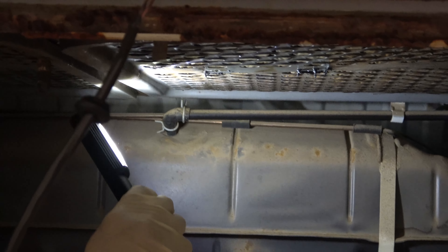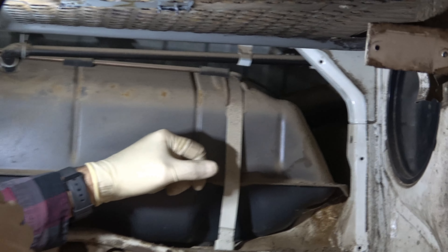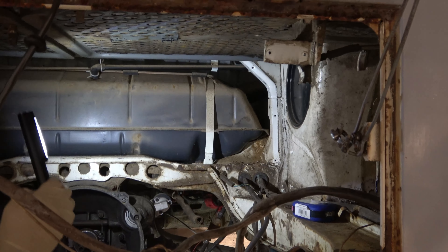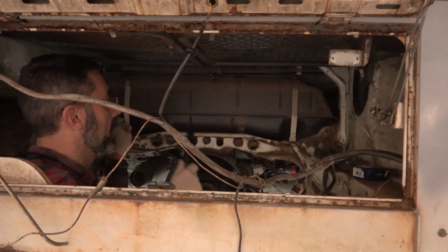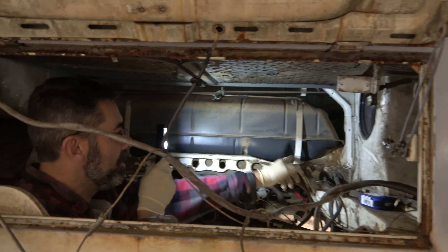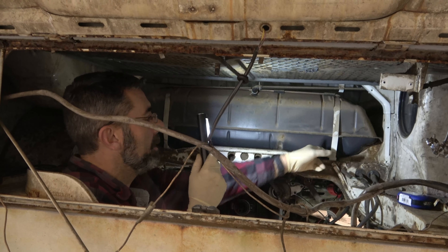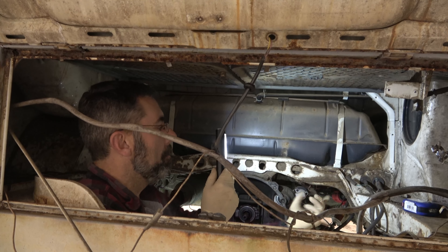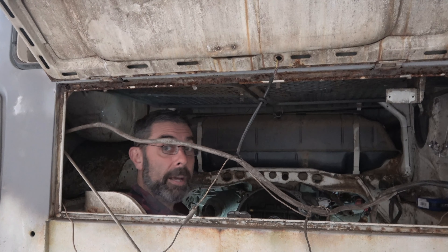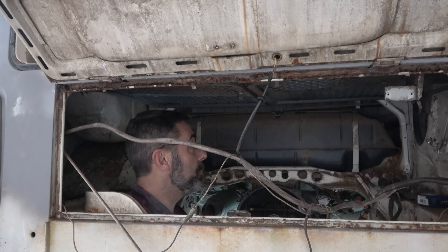The actual line that goes to filling this thing is cracked all over the place — I imagine the first time we filled it up, we'd have a nice waterfall of fuel coming out. You can kind of see the stains from where it was doing that at some point. The next thing I'm going to do — I'm probably going to have to cut it. These metal straps: the second I tried to turn the bolt, the straps started to turn, and we could actually end up damaging the straps, which I don't know if we can get our hands on. So I'm going to have Jen grab a pair of channel locks and hold it, because if I can just break the bolt off the bottom, that's no big deal. But if I break the entire strap, that's a big deal. So the next step is we're going to go ahead and pull the tank, and then I'll wrap up today's video with that once we get it out.